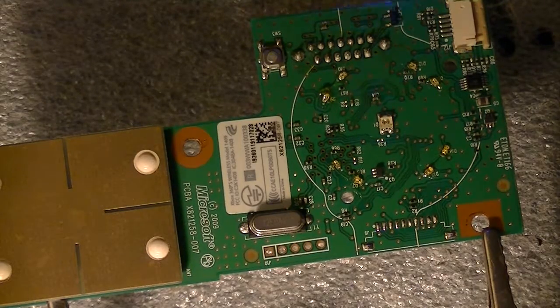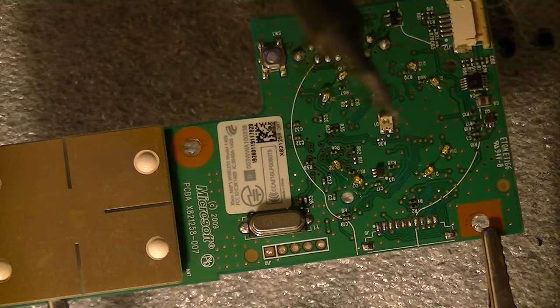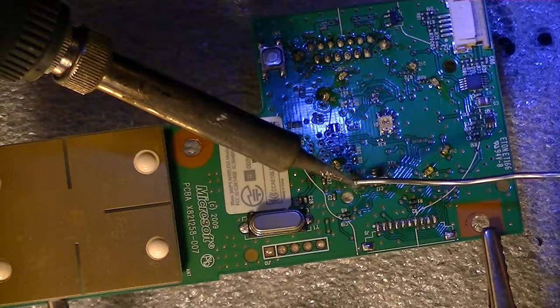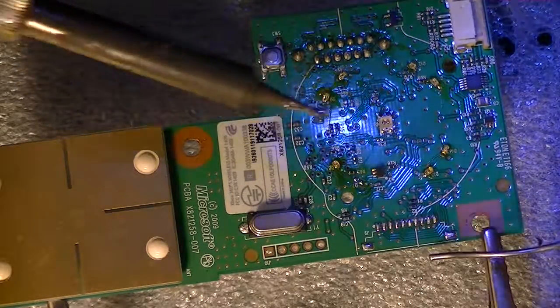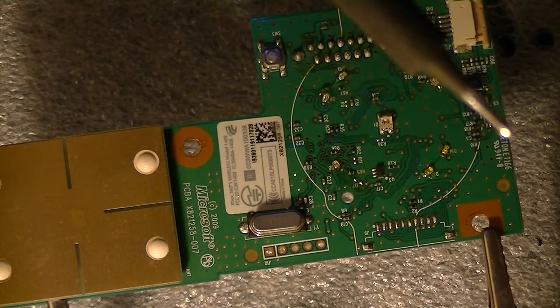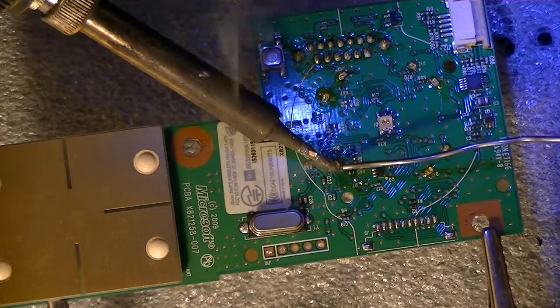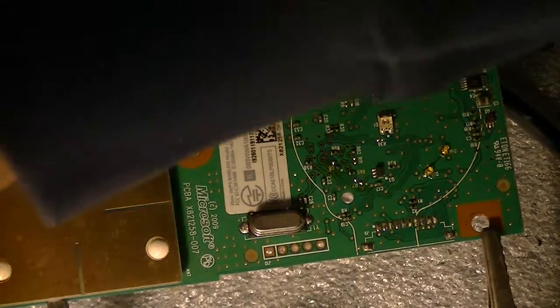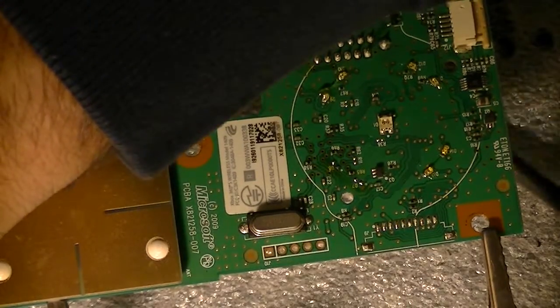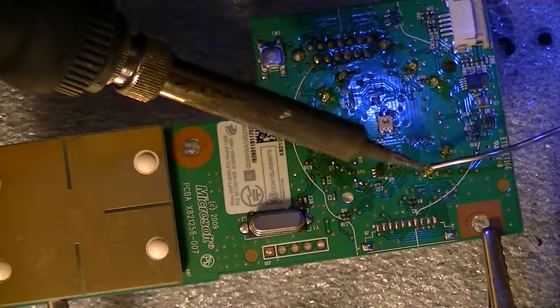They changed anyway. But anyway, alright, so now, to get started, you're going to have to apply some solder with it to replace it. So what you got to do is apply it, run it back and forth, and it comes right out. See, it came out. Okay, so now, clean the tip, go to the next one. Came right out. Clean the tip. Make sure the tip is nice and clean. All right. Do these two up here.